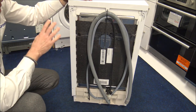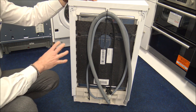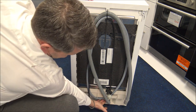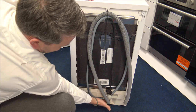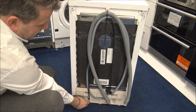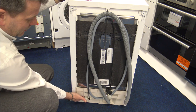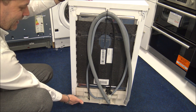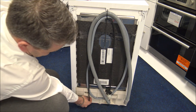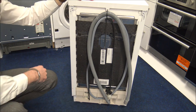I'll just show you around the back of the dishwasher — this is more relevant if you want to install it yourself, or if you're wondering where pipes are going to be located before you put the dishwasher in. Both the waste and the water connection are at the bottom here. You've got quite a channel at the bottom, so if you were limited for depth on the appliance, at least you can put both water connection pipes — the water inlet and the waste outlet — almost within this channel. The electric cable is within that same channel as well. A really good design by Hotpoint.